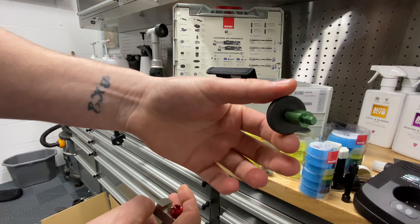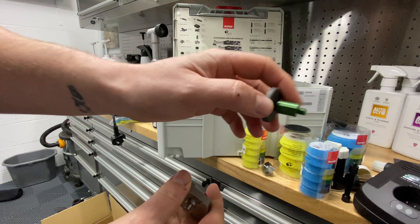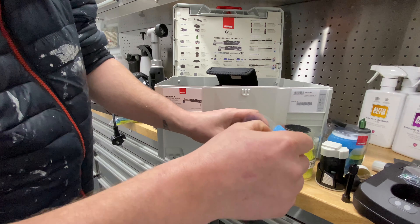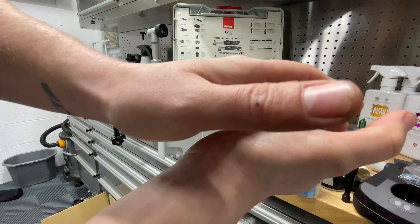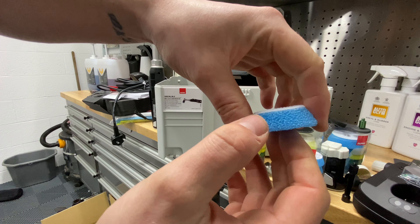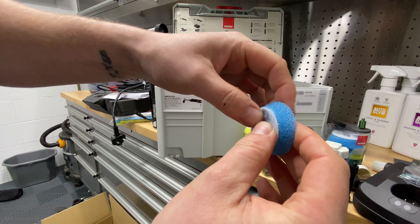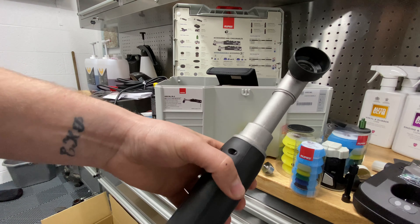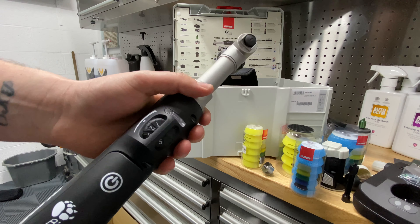The two most common attachments are rotary or the 12mm throw. With rotary, given the size of the pad and the pressure you're putting on the machine — people are scared of using rotary machines, but you're unlikely to do damage with a machine of this size. In terms of pressure, you want enough so that the pad is about 50% compressed — not so much that it's completely squashed, and not so little that it's not doing anything. Rupes recommends this 50% compression as well.